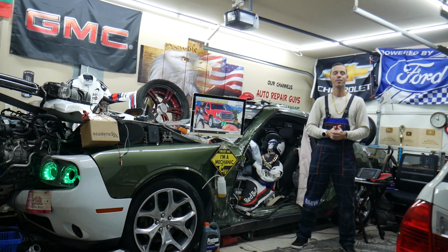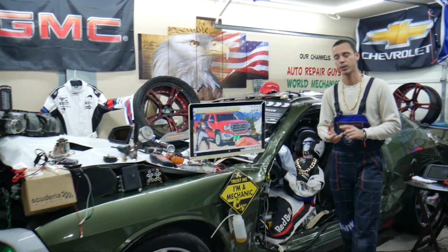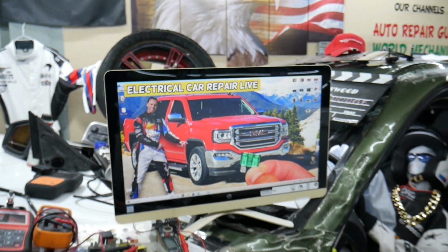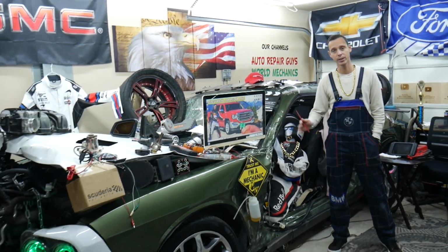Hey guys, welcome back to Electrical Car Repair Live. Super quick, helpful video to any of you trying to find fuses and relays for the USB ports on GMC Sierra, that generation here from year 2014 to year 2018. If you need to find where these fuses are located, we'll cover that today, relays as well.